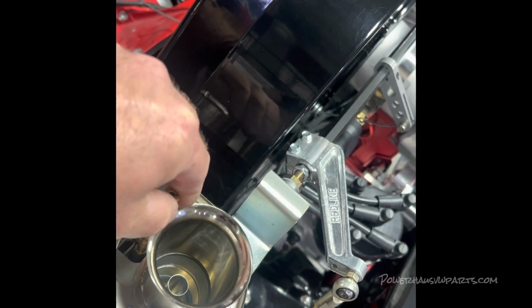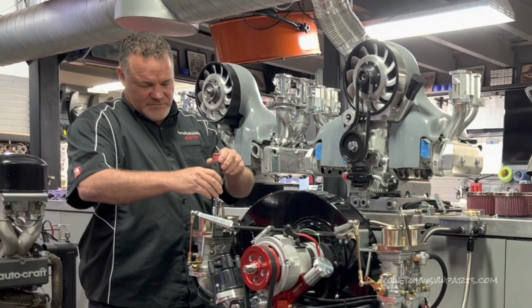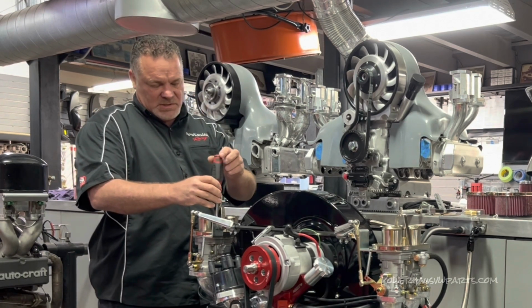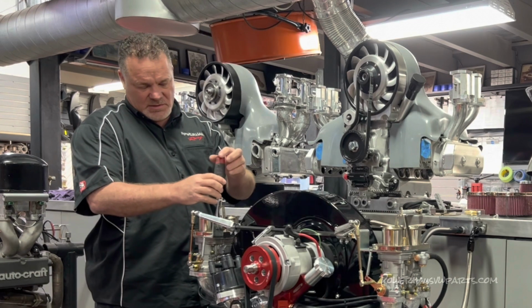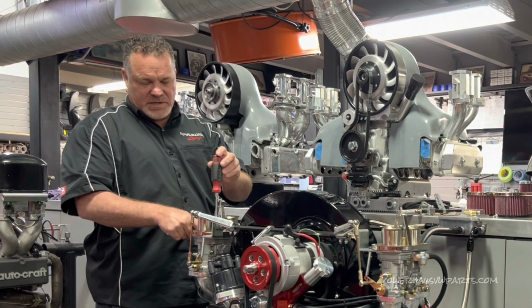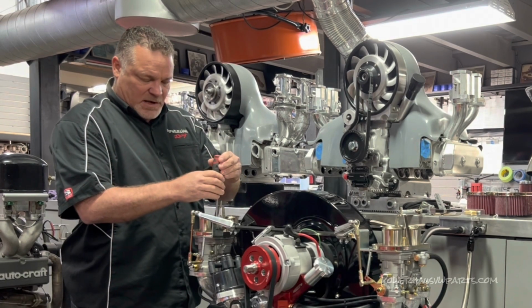You can set this down in there, and then you tighten them up. So you really want to get it started by hand, and then get the screwdriver in there, and then tighten it all the way down. What I noticed in checking this is when it gets close to the bottom, this side was getting a little tight, which means those little brass threads got a little boogered up, and it wasn't going all the way down, seating itself against the pocket.